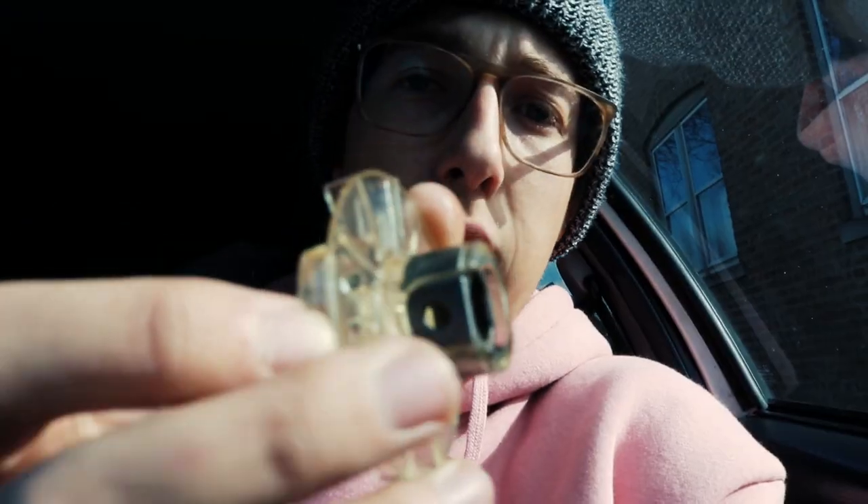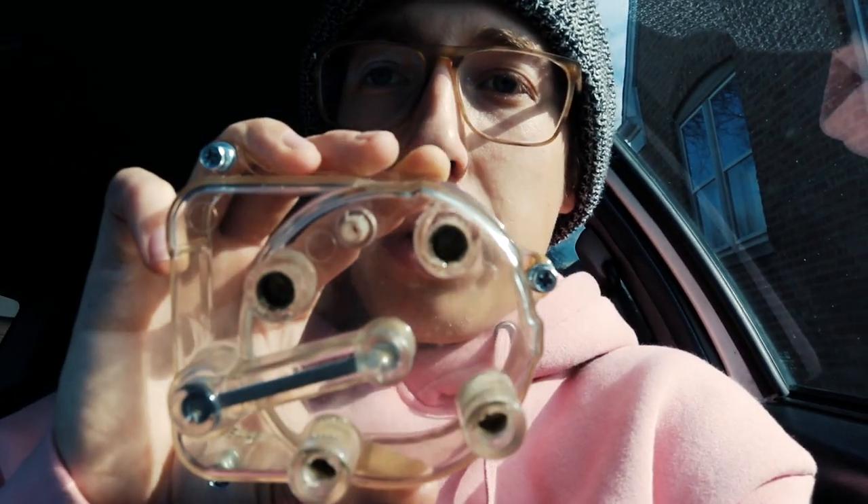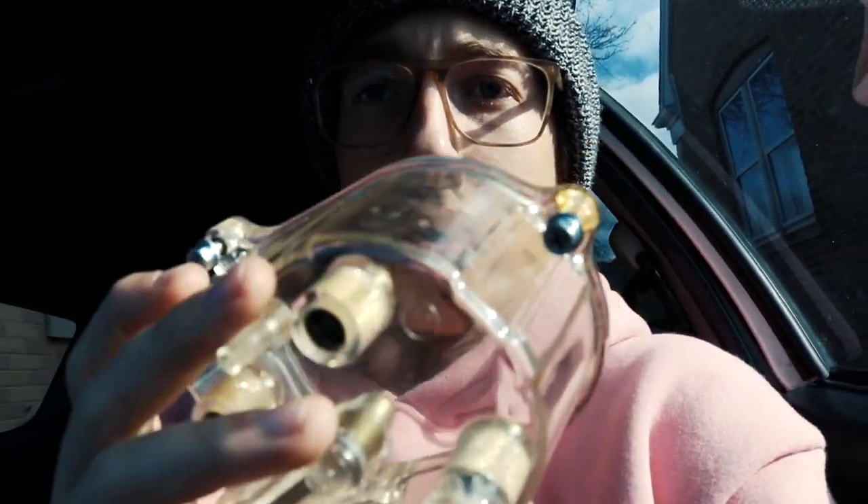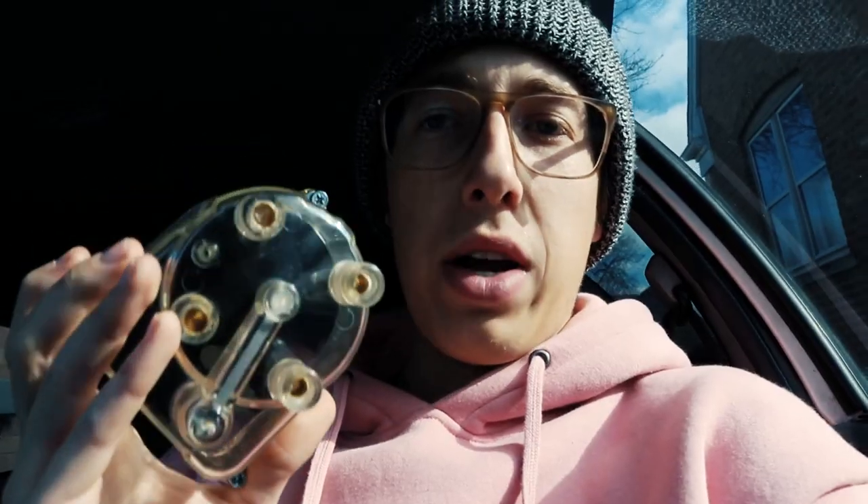You just put the screw back through this hole — that screw locks the rotor onto the distributor. Then all you gotta do is put a little bit of dielectric grease inside of these terminals. I got some dielectric grease on my pants — that looks sketchy. Next you have to put this inside the distributor — this is like an O-ring but it's not really an O, it's a D. You gotta put that inside the distributor side, not on the cap, on the distributor — it'll fit into a slot nice and easy. Then you just put the new distributor cap on and tighten down the screws. It should come with brand new screws already set inside the distributor cap. What I did is I took the old cap off without unplugging the cables, so when it came time to plug the cables into the new distributor cap, I just took them off of the spots where they were on this one and matched them up with the new distributor, so I don't have to remember which cable came from where.